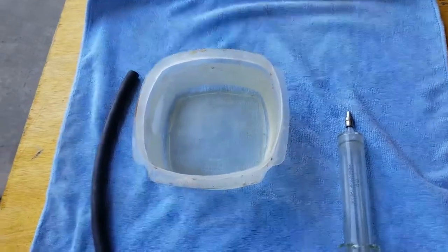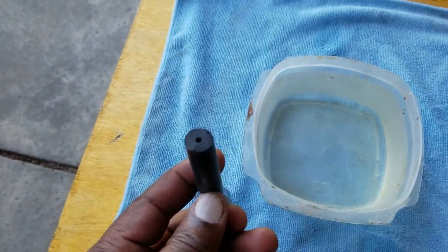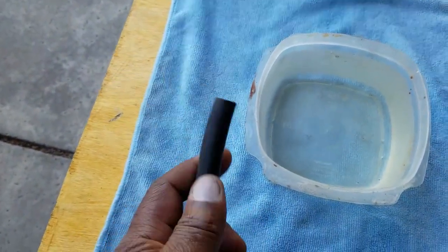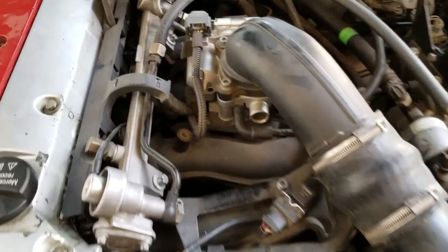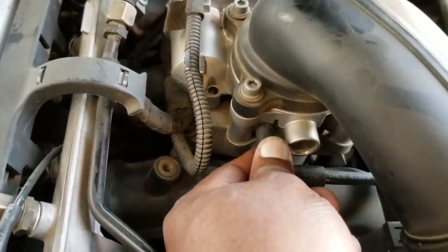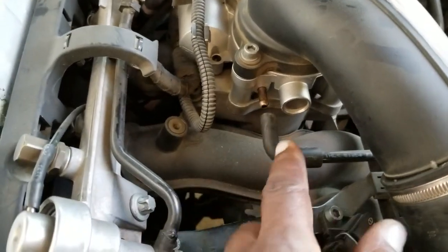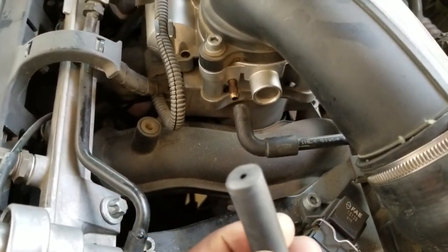Today I'm just going to use water, I'm going to use a syringe, and I'm going to use this little small hole piece of rubber hose. I'm going to take this little rubber hose and attach it right here on the throttle. There's a vacuum connector right here, so I'm just going to take this tube off, and there's a connector, and I can just take this hose.